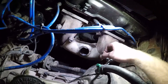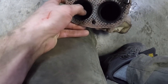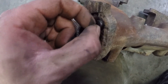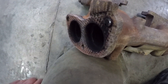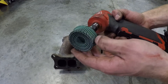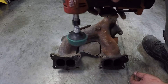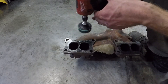Be careful in case it's warm. That old gasket is pretty well stuck on there. There's the problem right there — that broken stud or bolt. We're going to have to get that out, which is going to be a good time. We also need to clean all of this off using a right-angle die grinder and these poly brushes, which are softer than steel and aluminum so they clean the surface without destroying it.